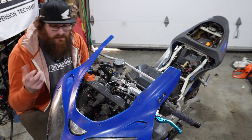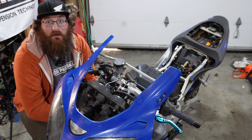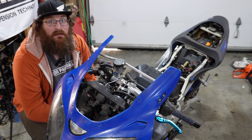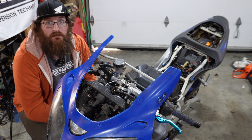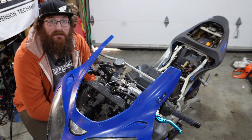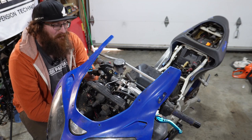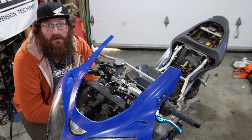These plastics are just cracked, damaged, and broken. It does run — I got it running — but it's not running on all cylinders. It's running on two or three at idle, and once the mains hit it seems to run on all four. I think some of the jets are clogged up in the carbs, which I knew was gonna happen. I was really hoping I'd get lucky and not have to disassemble and clean a bunch of carbs, but I was being lazy and hopeful.